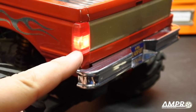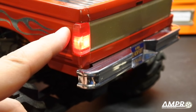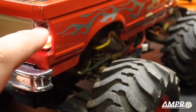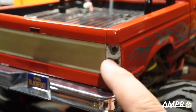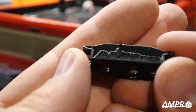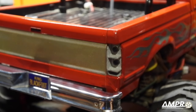These are typically all red lights for the style of Ford truck, but that shouldn't stop you from wanting to install a turn signal on top or something of that nature. On the right it's already installed on the truck. Now, what you're looking at are the production buckets — these here are some prototypes made in a very brittle material, so I typically don't offer those for sale. Normally these are the SLS — selective laser sintered nylon units — which are very forgiving and very durable.